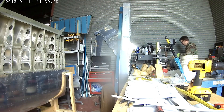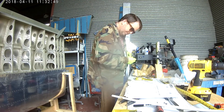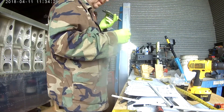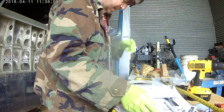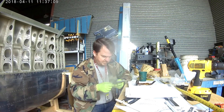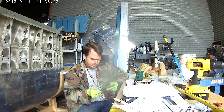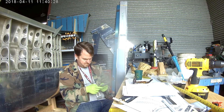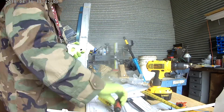This one is a little bit different. The holes you drill for this — you drill two holes through the end — and it's going to have a threaded end cap, not the unthreaded female end cap from before. It's actually an AN490. Unfortunately, Vans sent me the wrong size AN490s, so I had to order four of the regular ones from them so I could actually make this, because they sent me the ones that are too big.